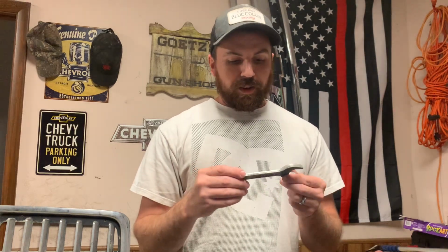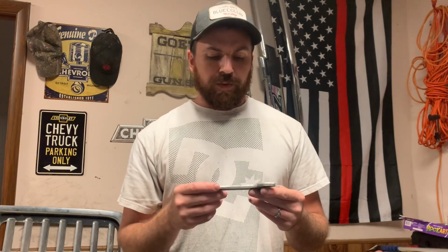Here's an old wrench I had in my box. It's a 1 inch. It's actually a combination wrench. It was 1 inch on one side and 15/16 on the other. So I was trying to get the ICP out of an older, like the first gen 6.0 Power Stroke. It's on like the back side of the motor, so you got to kind of get up underneath, in between the engine and firewall. I think there's a heat shield you got to get off, and then you can get that ICP sensor out of there. But it's actually a 1 1/16 I think you need.